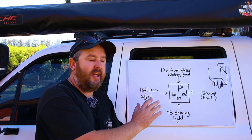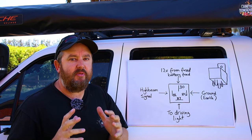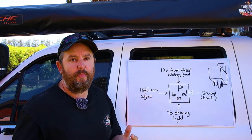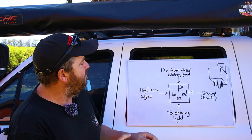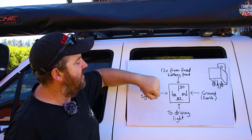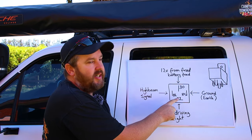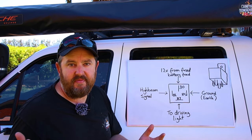This is only a beginner's guide, so I'm not going to overcomplicate the internals of a relay. You get four pins on a standard relay — you can get more pins, but this is the most common one for spotlights and light bars. You have your feed straight from your battery — that's your positive through a fuse first — and then to your relay on pin 30. It then runs through to pin 87 and comes out there, going to your driving lights. That's very simple.